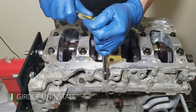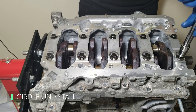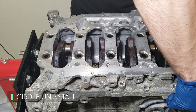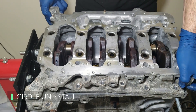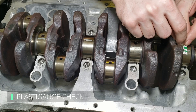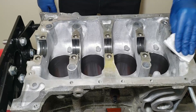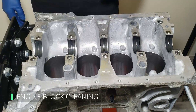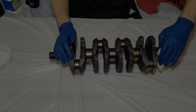With all the fasteners torqued to spec, remove them in the opposite order of install. To remove the girdle, carefully pry it in the designated areas, minimizing movement — there's no lubrication, so it's all metal-to-metal contact. Plastigauge comes with an indicator that tells you your oil clearance based on deformation. All mine fell into the 0.038 millimeter size, showing my clearances are within tolerance. Now clean everything one more time to remove the plastigauge and prep for the final install, including the thrust bearing surfaces.